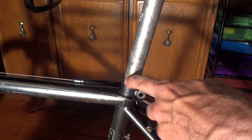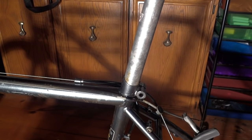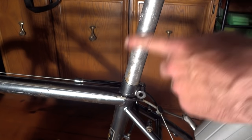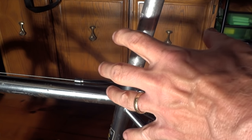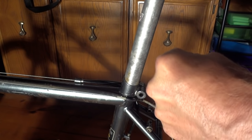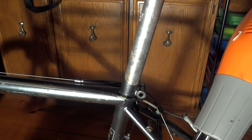I've been dripping the ammonia down along the outside of the seat post and it's still not letting it do its work. I'm going to try another tactic — I'm going to use a heat gun. I'll go ahead and heat the seat post so it expands, and then possibly when it contracts and shrinks again, maybe it will break the bond between the seat post and the frame. I'll try it and see what happens.